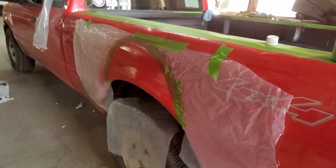Now, like I said before, this paint color is still in pretty decent shape, and it's not dramatically sun faded, so this paint should match relatively well, as long as it is indeed the same paint code. I mentioned before, the Harpy Motors can, and this paint is so much better than the Duplicolor. You pay about 3 to 4 times as much, at least for this color paint, as if you buy it in the kit like I did.